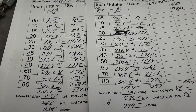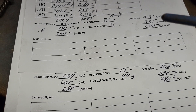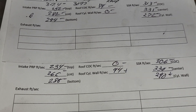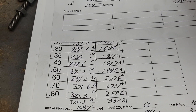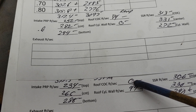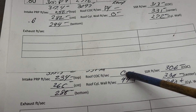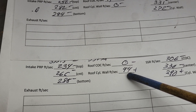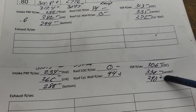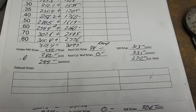Let's take a look at our airspeed to see if we can figure out what happened. Our pinch is not as happy — minuses across all of that. This was taken at 600 lift: last one was 294, this one was 291, so it's flowing a little bit less. The center of the cylinder on the roof side — remember we don't have the ramp anymore — I'm able to measure the other side of the bowl: dead, completely dead, zero. The other side picked up a little bit to 94, just the opposite of what we had before. Our short side: minus, minus, plus. All in all, a more unhappy port, even though it was only a couple CFM different.